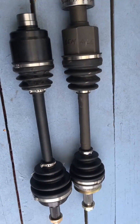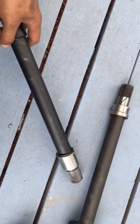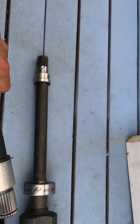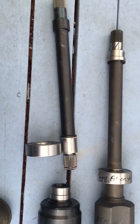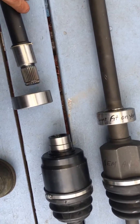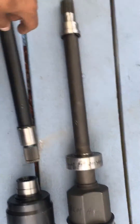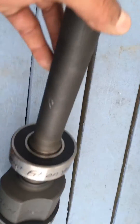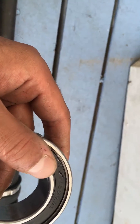That's my problem. It looks like a pretty decent built axle, but I'm concerned about the intermediate bar — I just hope it's not something that could crack. Either way, this bar is not allowing me to install it in my car because I can't put that bearing on it. Does anybody know if there's another bearing that fits? Every other axle I have uses the same bearing — part number 83B231.